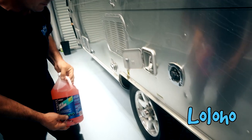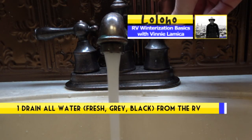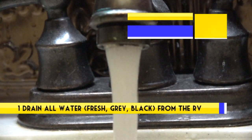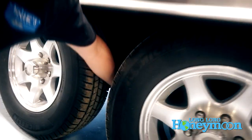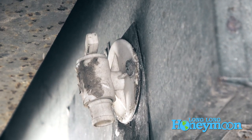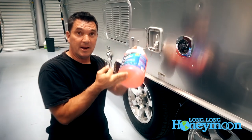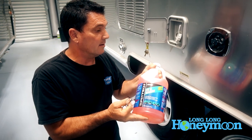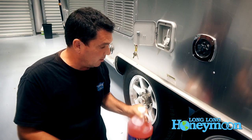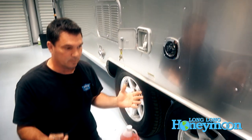Let's simplify this. Here's what you want to start with — make sure the fresh water tank is empty. There's no water in there currently. There is a nipple at the bottom of the tank that allows you to open it and drain the water out. So we would start with that. We could simply introduce the antifreeze in its current form into the fresh water tank. Depending on what kind of coach you have, the fresh water pickup may not be close enough to the bottom and you might need two gallons. Once you've introduced a couple gallons into the tank, you're ready to start the process.